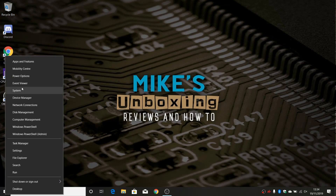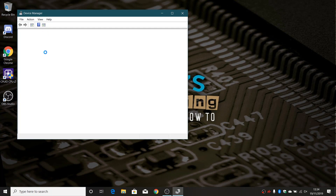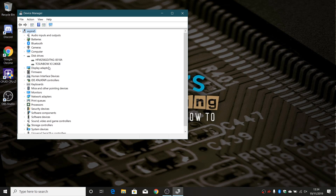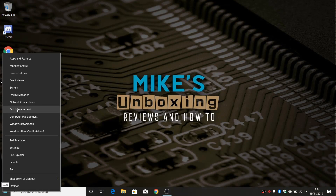Windows is back up and running. The first thing to do is check that the drive has been recognized, so go into Device Manager and look at Disk Drives — we're now showing the TC Sunbow X3 240 gig, so that's been recognized. Now we need to actually allocate some space to that drive, so right-click on the Windows taskbar and choose Disk Management.